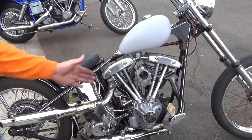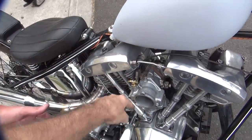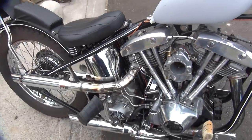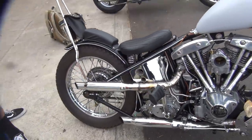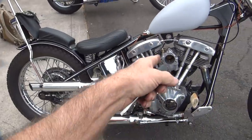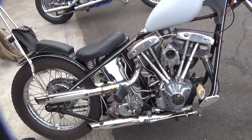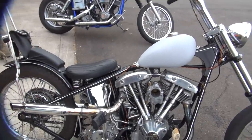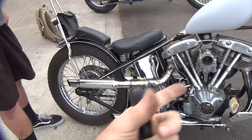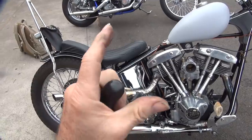But why? Just because it's fanning out? No, still the big hole? No, with the little stub, like having a finger right here. Oh, yeah, a little short stub stack. They may have a little teardrop one. Harley used them on their Screaming Eagle air cleaners. They had that plastic one that bolted in there, and you can modify and put them on these things a lot of times. It's plastic, because they were Screaming Eagle backing plates. They had a flat aluminum backing plate and a plastic low velocity stack that looked like the S&S air cleaner. If you have a broken S&S air cleaner, you just cut all the air cleaner away and keep the stack in there.